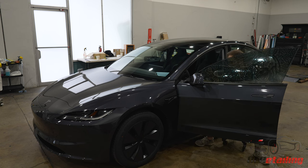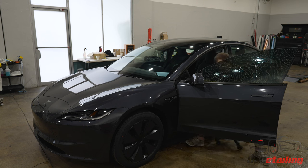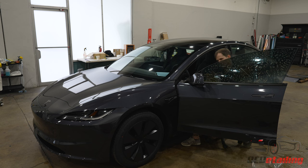That actually continues on to what I was talking about earlier. When you look at a sun ray and you see all the little specks floating, all those are potential contaminants for me. That's just dirt and debris floating around in the air. Anytime the adhesive or the final glass is exposed to the air, there's a possibility for some type of contaminant to get up underneath it. And once it does, it'll seal the moisture and air around it, causing a little pocket to form, and that air pocket will end up drying white.